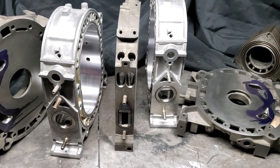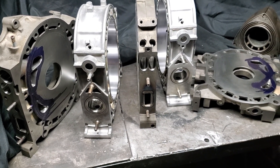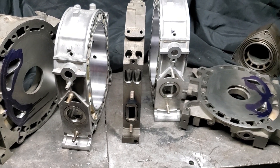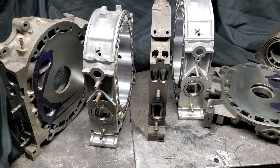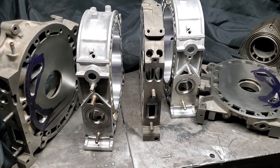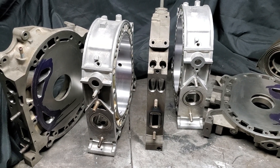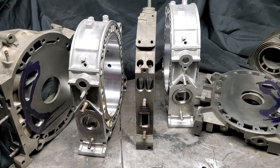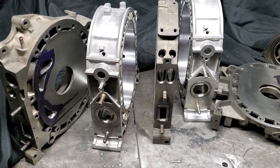We can do a bridge or a half bridge on this, but that's going to very much change the effect of the motor. We're going to lose bottom end. It's going to sound amazing — that's going to be a very brappy motor — but I want to remind people that you can't unbridge it. So depending on what people want to see, we either need to go street port and maybe bridge port later, or if the time is now, let me know and we'll consider it.